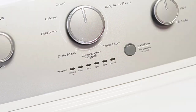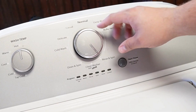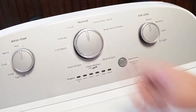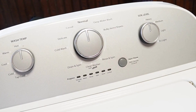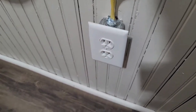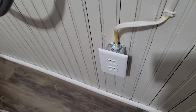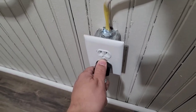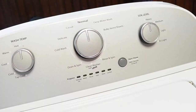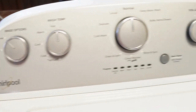We can do the first two resets in sequence. First, rotate your washer's control dial counterclockwise until it's at the north or 12 o'clock position. Once that's done, unplug the washing machine from the wall, and with the unit unplugged, wait about a minute before you plug the power cord back in. You should hear a faint clicking noise from the back of the washer relay as it boots up.